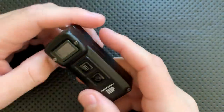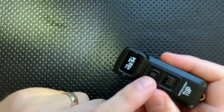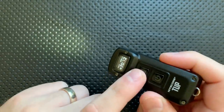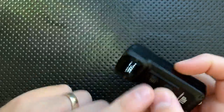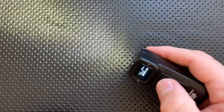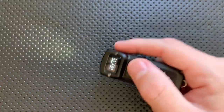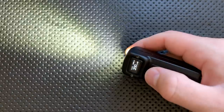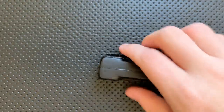The interface on this guy is actually generally pretty good. You press the power button to start it up — right now it's on high mode at 200 lumens. Hit the button again and it goes down to the one-lumen low mode, then 15 lumens, 65 lumens, back to 200, and if you hold down the button it goes all the way up to turbo mode at 1000 lumens. You only get about 30 seconds of turbo before it steps down due to thermal issues. Having separate buttons for mode means you can very quickly adjust rather than having to hold down a button to cycle through.